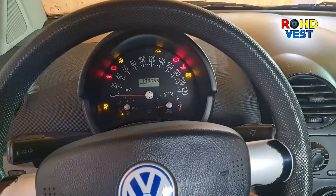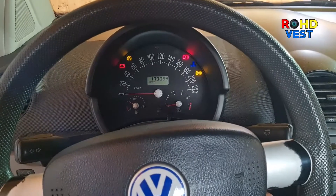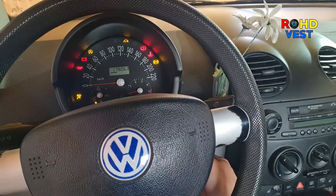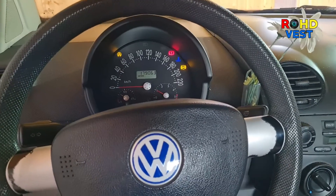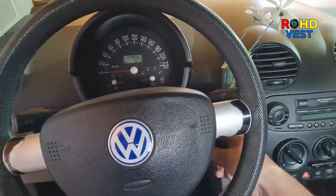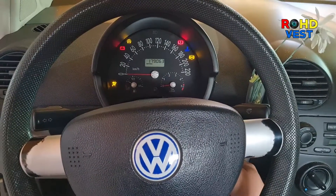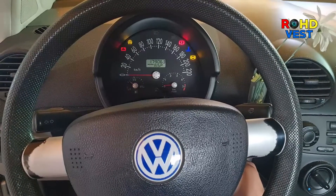Hello to all my followers. In this video you will see a new Beetle 1.9 ALH from 1999 with starting problems. I told the owner to change the starter but he didn't want to do that. The starter does not turn the engine enough for the ECU to start the injection. The ECU software has been modified so that the injection starts at even lower engine speeds. The owner also wanted to increase the power of the car. It was time for an old school job because I had to desolder the flash memory chips from the ECU to read them.